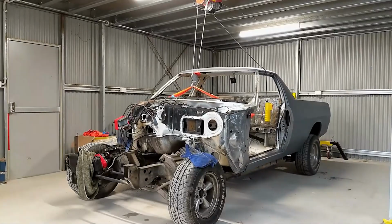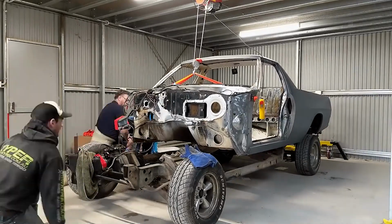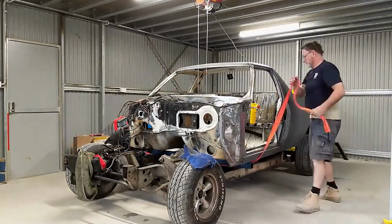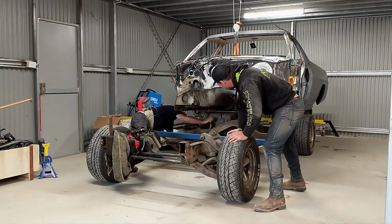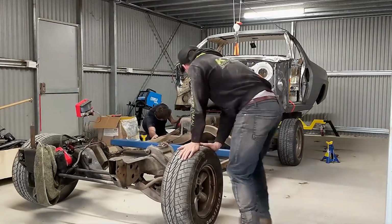I've got to try and find a place to put this timber so that I can get the chassis back into the booth and drop the rotisserie front out and then do the reverse engineering process of getting it off onto the rotisserie to get it off the rotisserie. So that's putting the hoist back on, the mezzanine, taking the front bolts off, hoisting it up, taking the front of the rotisserie off, wheeling the chassis in, and then taking it down with the back of the rotisserie, and eventually take that rear of the rotisserie off, and the body shall be back on the chassis.